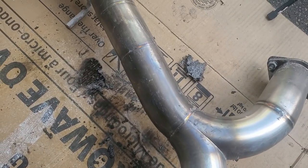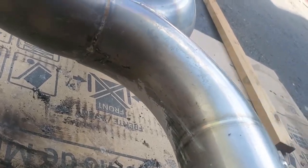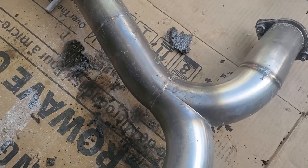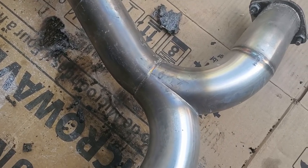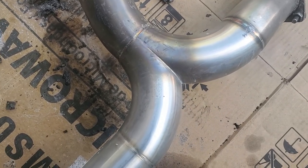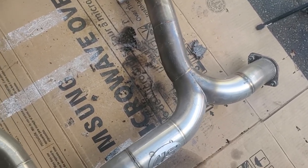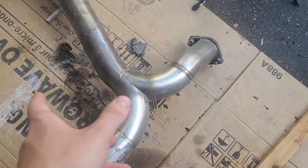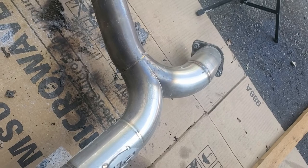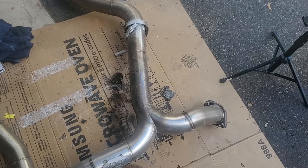Well, burning it definitely seems to be the way to clean it up. I got it pretty close — there's a little bit down there but it might come off. The only side effect of the torch method is you do end up discoloring the stainless steel, but you can get rid of it just by simply polishing it. I'm honestly not too worried about it — I'm just going to clean it up. If the new owner decides to clean it they can, but you're never really going to see it. I'd rather a little bit of discoloring than a bunch of plastic on it. Anyway, I'm going to go ahead and wash these up and see how it looks.